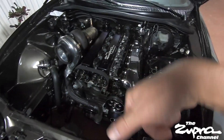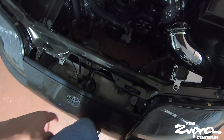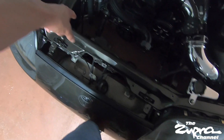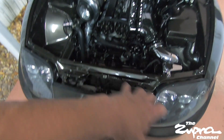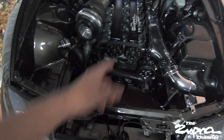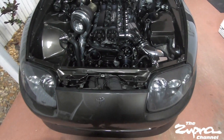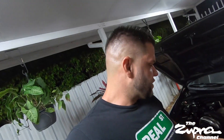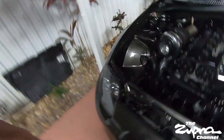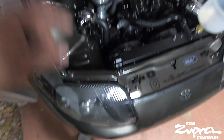Today's Friday so I have a little more time. I'm going to go ahead and install the radiator, put back the fan controller, and connect all the connections at the bottom. I'll put in coolant and leave it overnight to burp out on its own, and also put fresh oil in since I drained all the oil to do the return line on the turbo. Tomorrow I'll finish - jack up the car, connect everything on the bottom, put the undertray cover back on, then we'll wrap it up and turn on the car. Fans are back on, went ahead and did the connections down there - all I'm missing is the belly pan and the serpentine belt. I'm going to leave it for tomorrow - already tired. Let it burp out by itself and then tomorrow we'll turn it on.